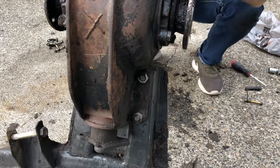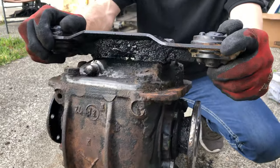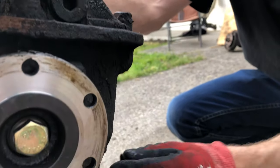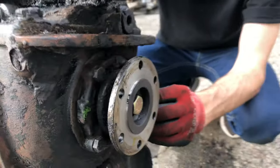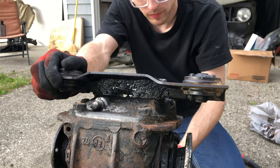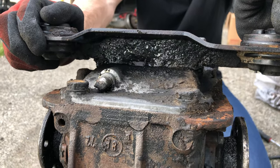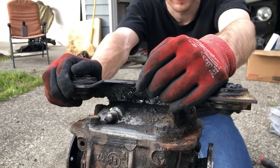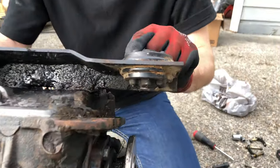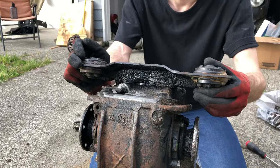Let me check it out. Yep, it's bolts. Just caked on there. I don't know what it is. Taste it. I'm good, man. It's just like the whole thing is caked. But if it was a leak, it would probably be different. It's probably a leak. Yeah, all the fluid leaked out when I was just laying in the garage. It looks like this little pin. It has a hole on there. Maybe when you rev it too hard and it has too much fluid, it just comes out of there. Looks maybe like people are revving it pretty hard. We were. That's all us. But yeah, these bushings look pretty cracked, worn. I mean, they have at least 50,000 miles. Yeah. And they're sagging.